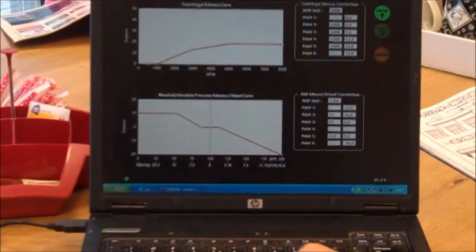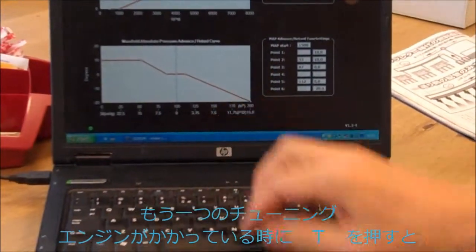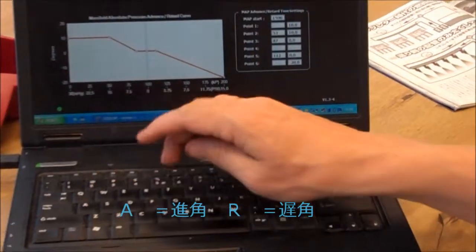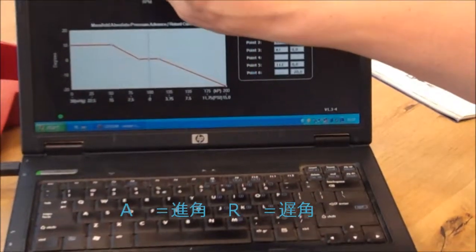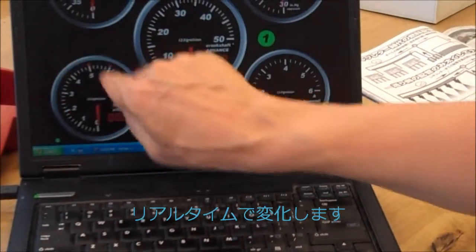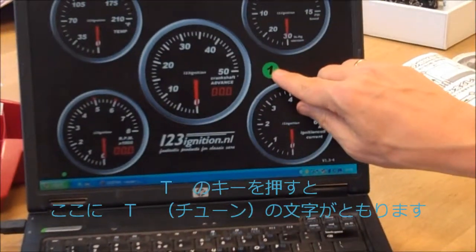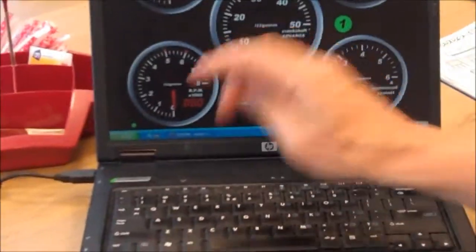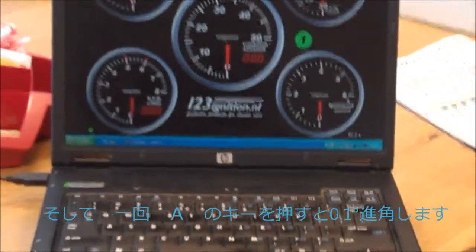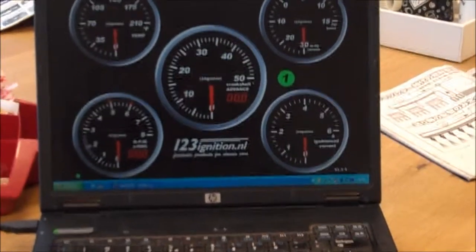Another way of tuning — you see that here — is when the engine is running, if you press T, then you can use the A and R keys: A is advance, and R is retard, in real time. So if you go to the dashboard and the engine is running, you see the speed and you see the advance. If I press T, this will start blinking — tune, curve number one, tune. So if you go to A, advance, one tenth of a degree extra comes. Advance, advance. You can hear for instance, hey, it's running with less noise. Sometimes an engine is producing a dark hum, and that is a sort of protest.